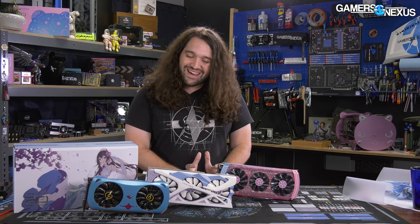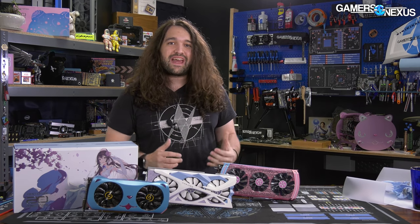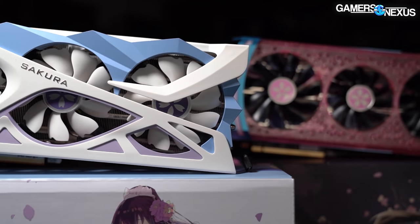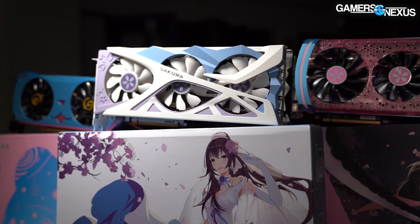So that's it. Yeston is a little bit weird, but the performance is really not bad. You'd think that a card where so much effort went into appearance would suffer in performance, but it's doing okay. It's not the best thermal performer — there's a 15-degree edge-to-junction gap that could be improved with better mounting pressure via different screw orientation or spring tensions. But memory temperature did surprisingly well and the MOSFETs we measured were fine. Everything is within spec and it's actually operating like a real product.